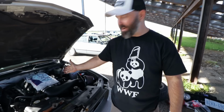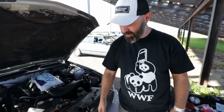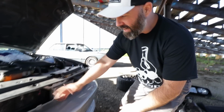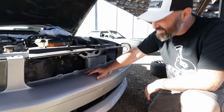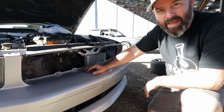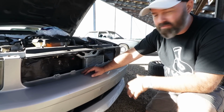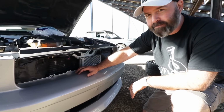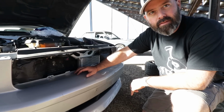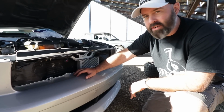We made it back to our home away from home here at Toronto Motorsports Park. Pulling all the ghetto stops with the ice on the intake manifold. Our super ghetto ducting survived the drive here, so that's a good sign. But the more we look at the AC condenser, it's just a mess. It's smashed down. There's just no airflow through it, and there's no fresh air that gets to the radiator. Period. It has to go through the condenser. Yeah, which is super crummy.